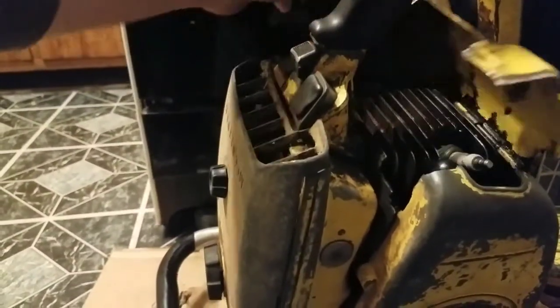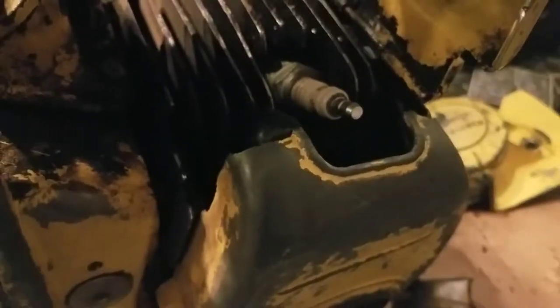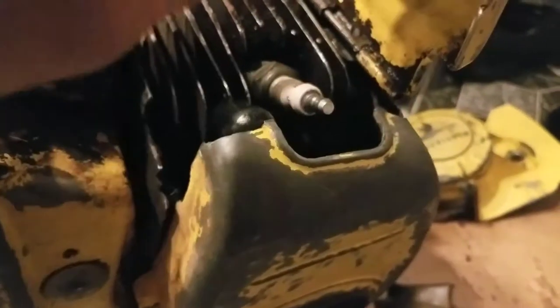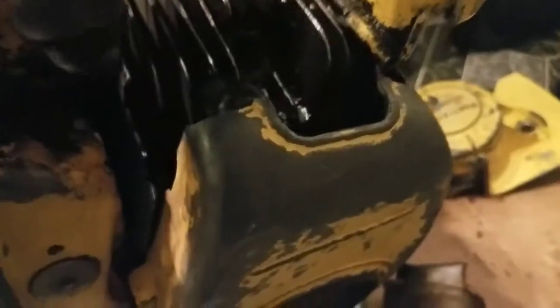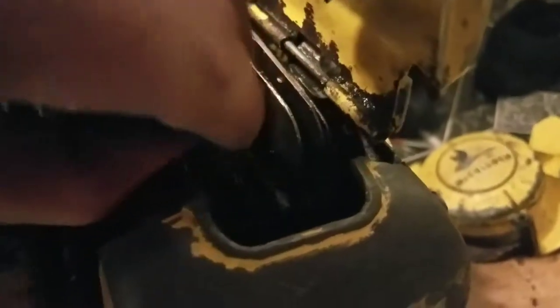What I've been trying to do with it, and have successfully done — waiting for it to cure — it came with a screw-in helicoil, which had the incorrect one. So I just got done about an hour ago tapping in and doing the proper save-a-thread one in there. The sealant is currently curing on it, and I have it lifted up so that none of the stuff I sprayed out the cylinder with dirties it up. It's got about 24 hours to sit before I can do that.